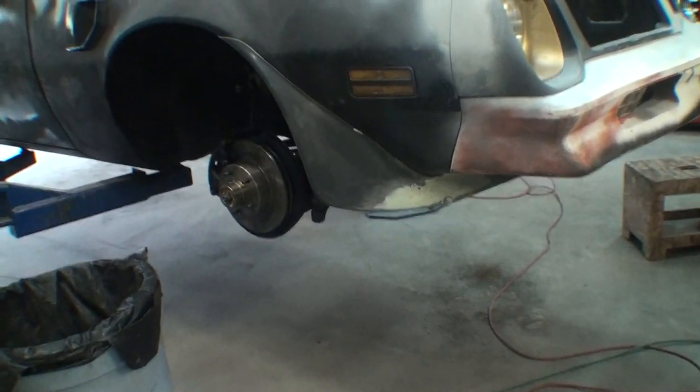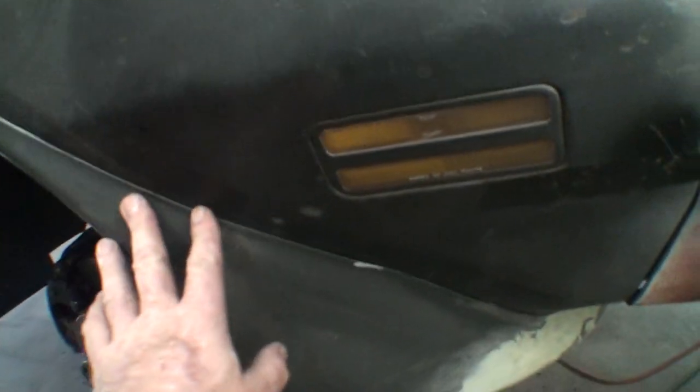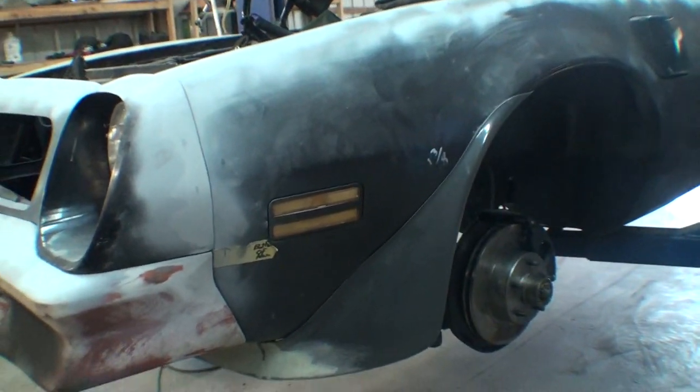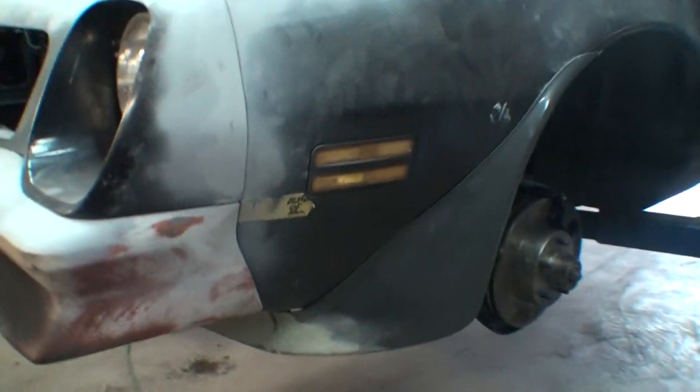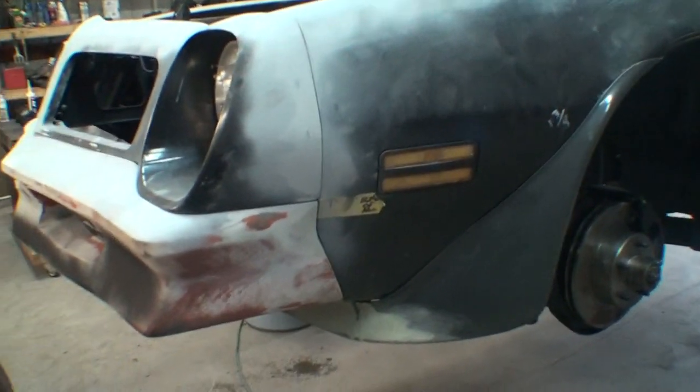Getting back to it — it's Monday. Now that I know how to melt and bend this stuff, I fixed this one. This is the passenger side — you see that gap there? It's no big deal anymore. To go over it again: just find a high point, put a screw in there, maybe a couple screws through here, heat it up, cool it off, and it'll stay in that shape.